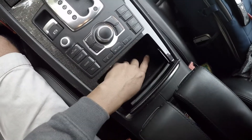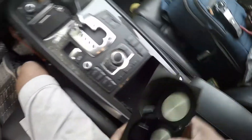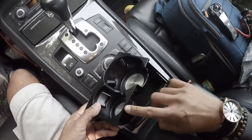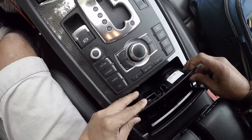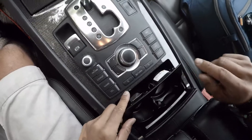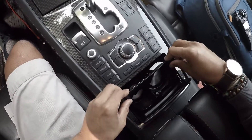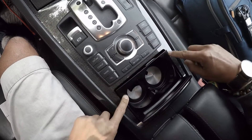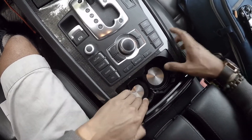The clips fit into these little slotted holes right over here. To put it back in, you're just going to seat the lip on the back of the cup holder's opening, then push down and towards the back of the car. Rotate it gently and you'll be able to hear it click into place.